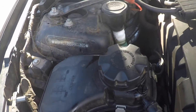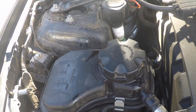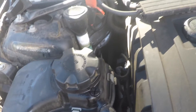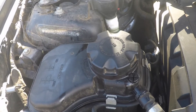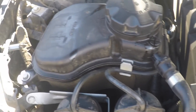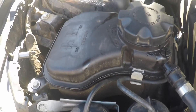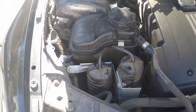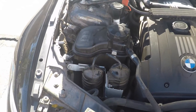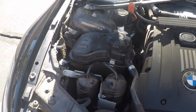So this is your coolant and this is the coolant cap. What happened was the coolant was spewing out everywhere from the cap — there was just a large buildup of pressure. That's a sign that your water pump is bad, or most likely your water pump on these N54 engines. It's the most common problem — it'll happen around 40,000 to 60,000 miles and you're almost guaranteed for that to fail.